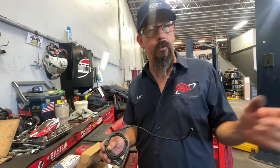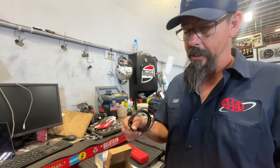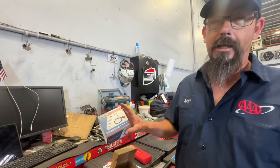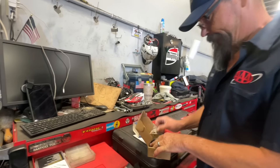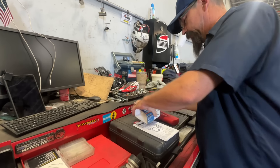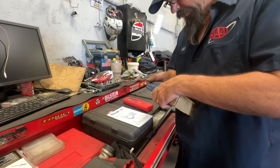Just the other day on a Toyota 4Runner with the 4.7L V8, the customer lost all compression in cylinder two. I was able to stick this borescope down in there and, even though it's not a high-dollar scope, get a very clean clear picture of all the oil on top of that piston. If you're looking for a good borescope without spending $200–$400 or a thousand dollars, this was about $75–$80. It's a Calvan Tools unit but I got it through the Mac truck from Justin.